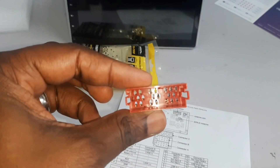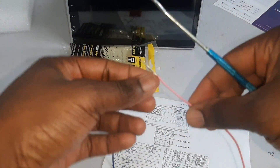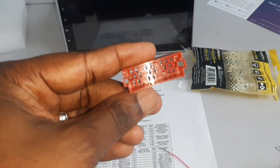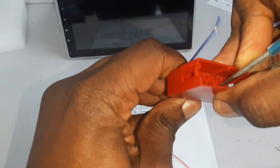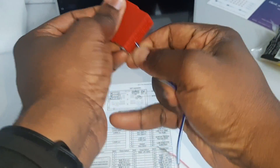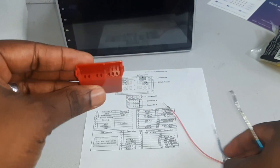To depin is easy — if you have extra wires like this, I'm going to depin one and cut one out, and that's how I got this pink wire with the pin, which I'll be using for my ground. To depin, you just have to find something sharp, push it to the pin, and then pull the wire from behind — it will come out. It's not easy; you have to push and pull.